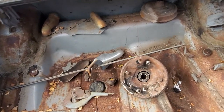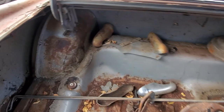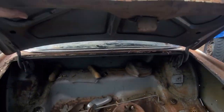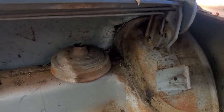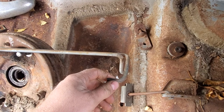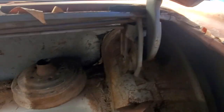The trunk is getting full of leaves again because it's not latching correctly. If I let go, that thing will come down and crack you in the noggin. What I found is this uses a torsion bar type suspension for the trunk lid, and one of them is broken up in here. So I just went ahead and got the whole hinge.